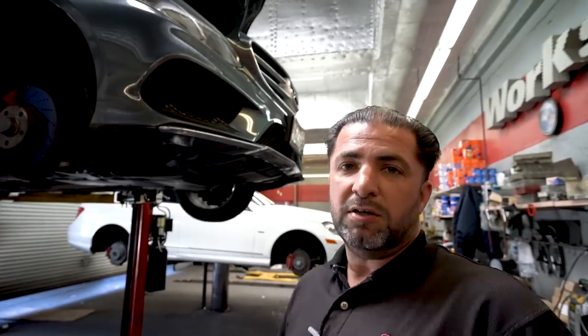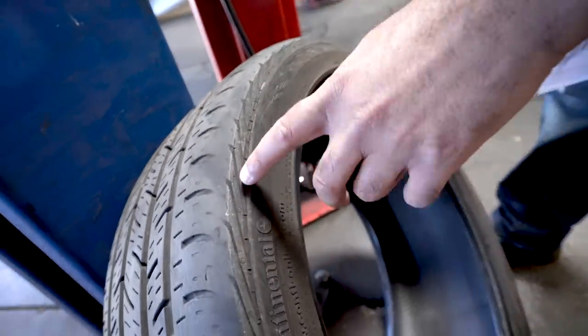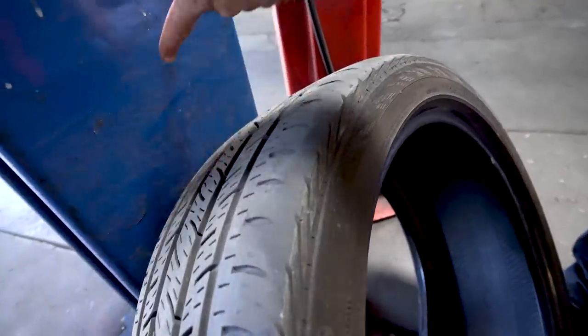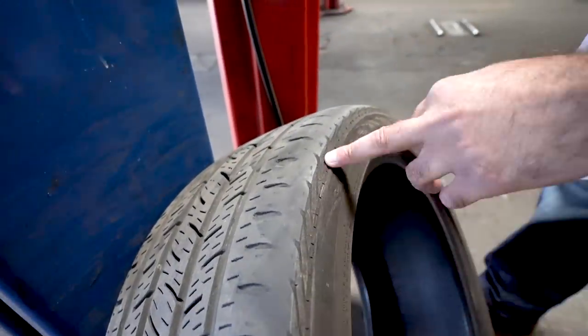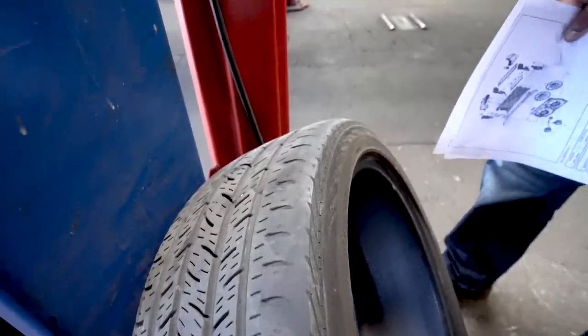It's really bad — bad due to a few things, not just alignment. The car is gonna need suspension work. We're gonna do arms on the car, left and right front. The car also has a coolant leak, which we're going to repair as well. This tire is pretty much bald already on one side but has a lot of tread on the other — that's an indication of not only bad alignment but also bad suspension. That's what we're gonna repair today.